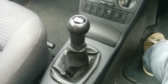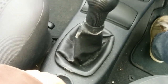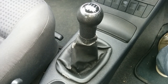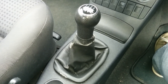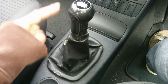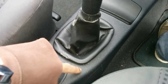Today I'm going to change the gear gaiter on the Polo. It's pretty tired as you can see, a bit battered, it really needs a change. I got a new one off eBay for about a fiver. First you need to remove the gaiter and the stick — this top bit. A lot of gaiters will sell you the top and the bottom together but you don't need to; you should be able to separate the two.